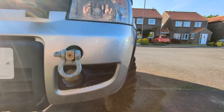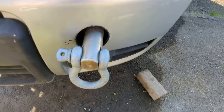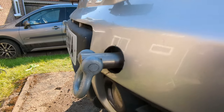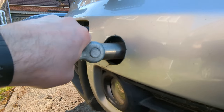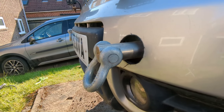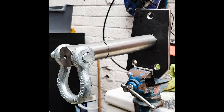The recovery points I made myself are my own design based on a weld-on swivel shackle recovery point that you can get on eBay, except these go all the way through the crash panel and bolt directly to the chassis legs. This is the strongest way I could see of doing it. I have towed a VW T5 with these recovery points and there was no movement or bending. There's more details about this on the Facebook page.